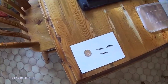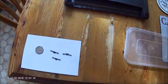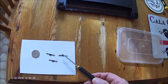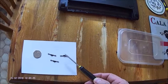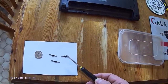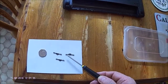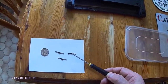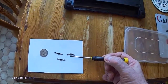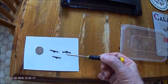These are the three little plastic tags. If you look very carefully you will see that they have arms on them and a little tab, and that tab goes in to hold the keyboard in place from beneath its position. You must release each of these arms very carefully and then the tag will come out quite easily. Be very careful not to let it spring out, as it could fly anywhere.